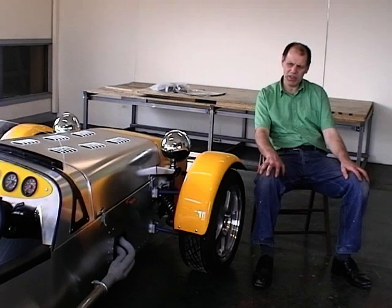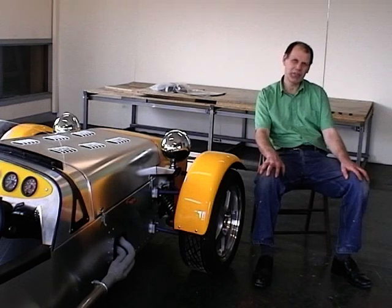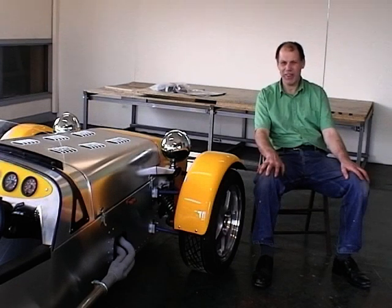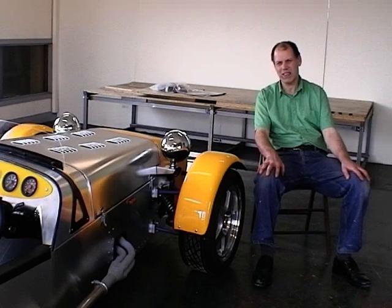The bonnet catchers that we supplied could have covers put over them in the form of just a stiff vinyl cover. Alternatively, you could buy the correct SVA catchers from Robin Hood. They're very popular. They're a rubber over centre catch and do definitely comply with the SVA test. There's lots of areas with the SVA test that we're still not certain.